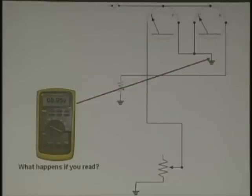Not much. Maybe nothing. Look at General Motors specs sometimes for a voltage drop on their car, 500 millivolts. Now, if that was on an oxygen sensor, a 1-volt circuit, 500 millivolts on the ground side, 500 millivolts on the feed side, oh crap, you've got no oxygen sensor in the car. Sometimes they will have these loose specs because, especially on a 12-volt circuit, they'll say, we're not worried about that particular setup.